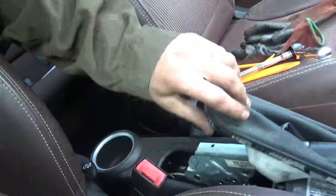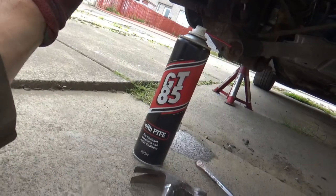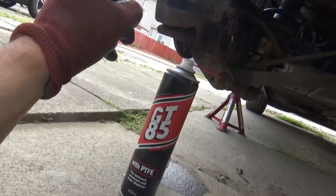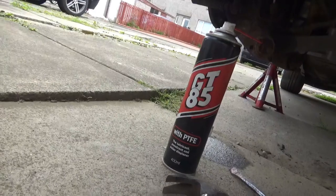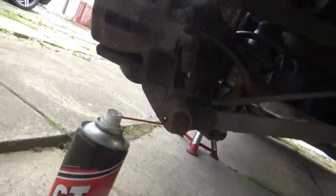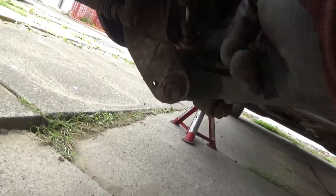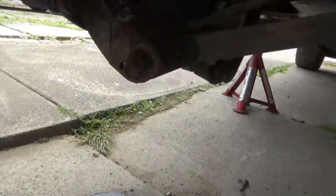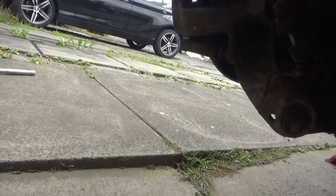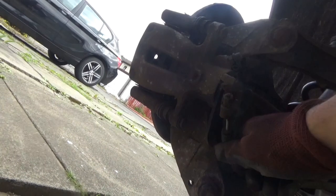Right, that should be enough so we'll jump back outside and pop off the handbrake cable. Prior to starting this job I gave all the areas that I'm going to be removing a squirt with some release oil. This GT85 - that's blooming good stuff. So basically you want to squirt some oil here because that's where your retaining clip is for the handbrake cable and also at the back of it, just so that it helps it slide off. Any other nuts and bolts that are exposed, it wouldn't do any harm to give them a squish either.